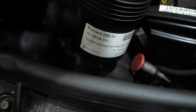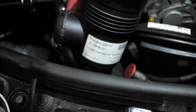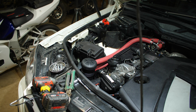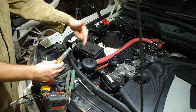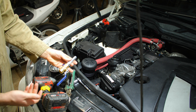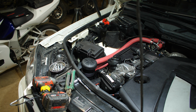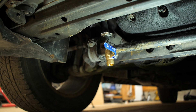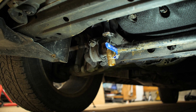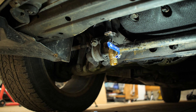Last thing to do is hook up your half-inch hose for the bottom of the catch can to drain it. I used a half-inch heater hose hooked onto a ball valve, with a barbed-to-threaded connection so I could just slide the half-inch hose on there. Pretty much just zip-tied it to the bottom of the frame — that location will change, I was just trying to get it set up so I could go for a little test drive.